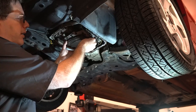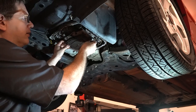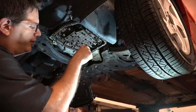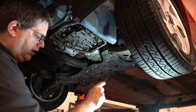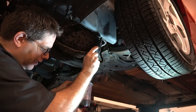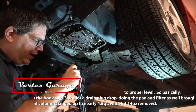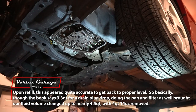There should be a little cork gasket — you're going to want to make sure that comes off with the old filter. One of the bolts is longer, so the bolt that goes in that particular position is longer than the other two. Here is the little cork gasket — it is there. We had four quarts, four ounces from the pan drain, and looks like we're adding another 10 ounces from the filter. So that's 14 ounces of additional fluid — almost four and a half quarts total out of seven. So remember that: four quarts, 14 ounces, or pi plus one.